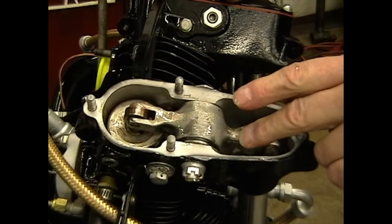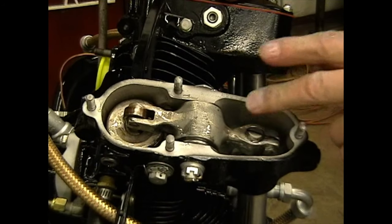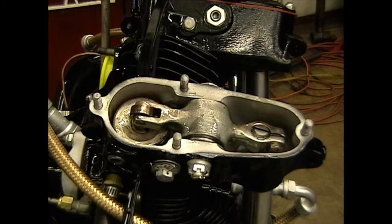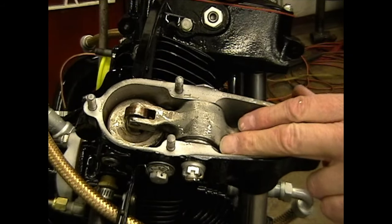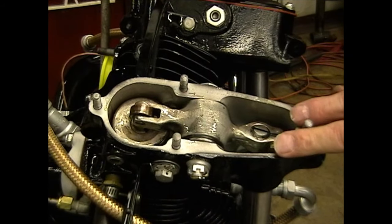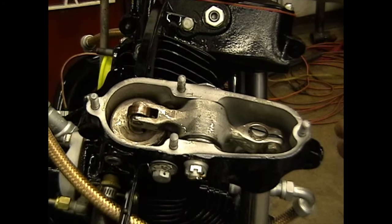At this point we could adjust both of the intake valves, then move the crankshaft to the next cylinder. The way I usually do it is to move from cylinder one to cylinder three, which is the next in the firing order, then to cylinder five, then seven, then nine, two, four, six, eight, and then you're back at number one again.